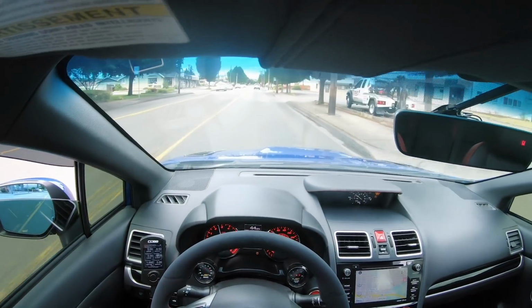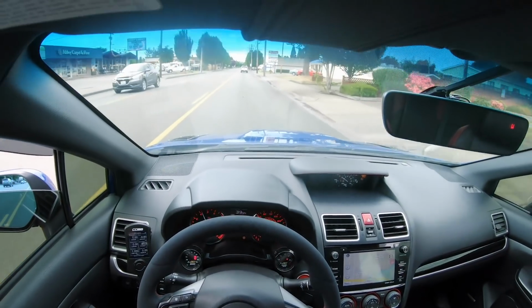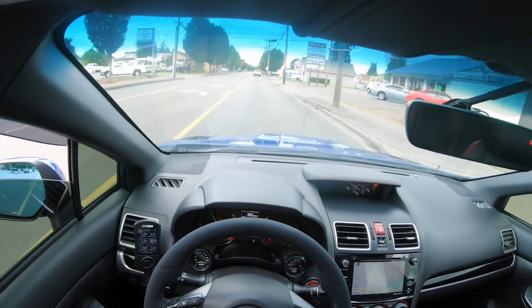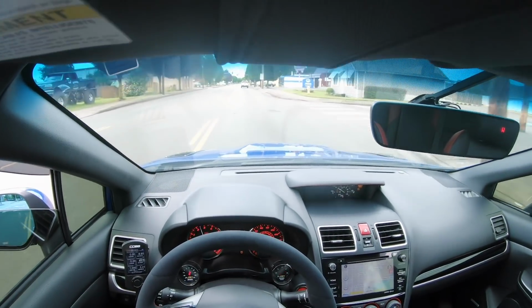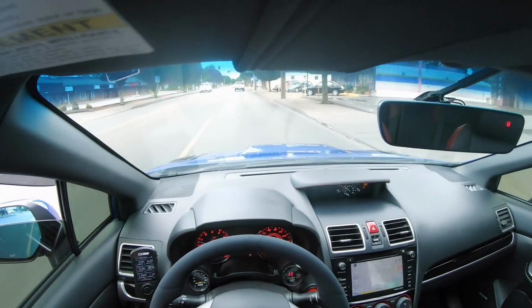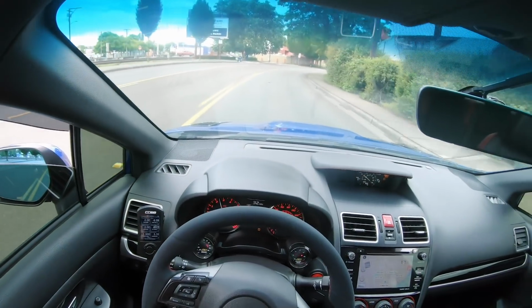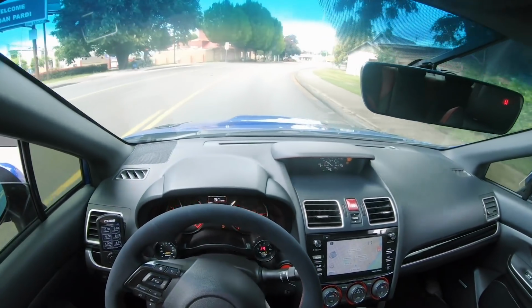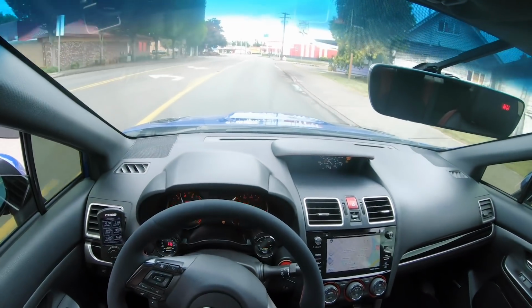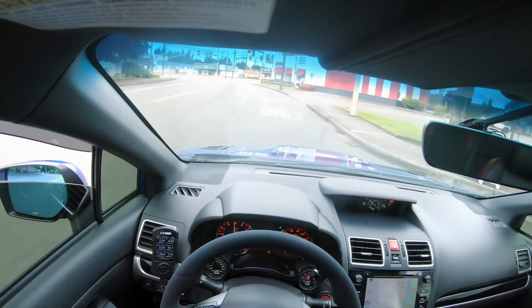But this turbo, I'm really glad that I went with the FP Blue. It's a really good feeling turbo. I would suggest it to anyone else who is on a stock block and looking for a solid turbo upgrade. But honestly, couldn't be happier with the car. Those are my first thoughts, my first impressions of the car. Injector duty cycle is still looking good on the 1050s. Intake air temperature, still looking phenomenal with that Visconti relocation kit.